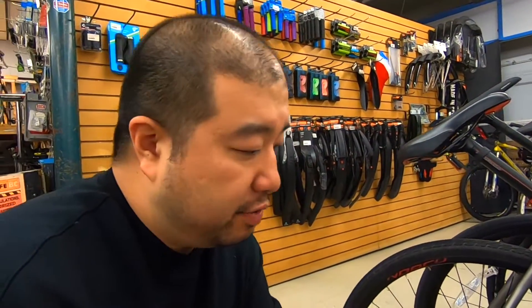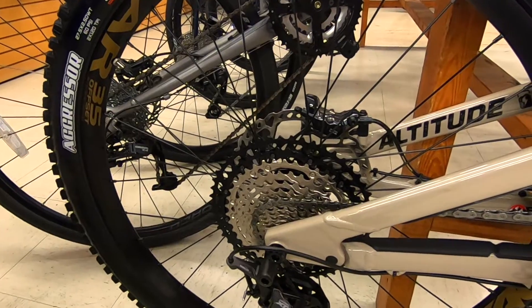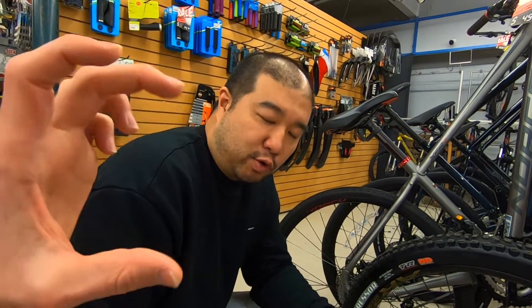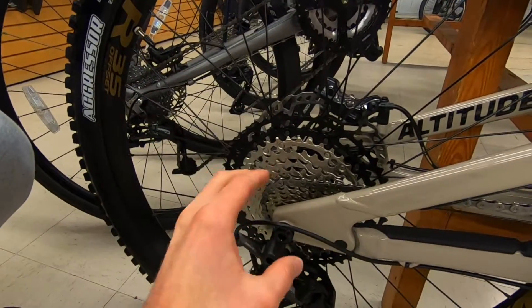A lot of the time I'm also seeing different hub spacing. The most traditional mountain bike spacing was 135x10mm. About six or seven years ago they came out with 142x12, and Boost is 148x12. So they went from 135 to 142 and now to 148, and that's part of what allows you to fit more sprockets.